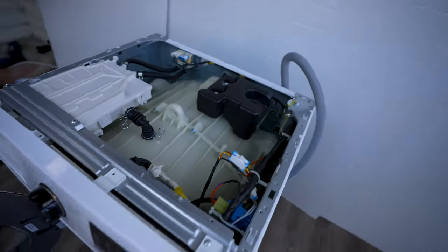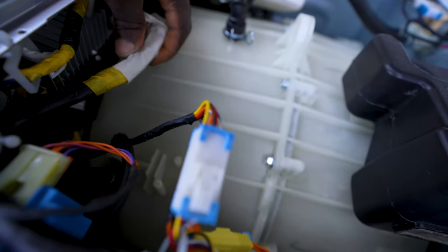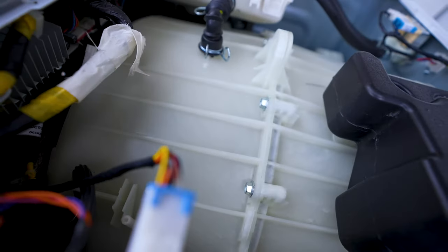We're going to have a look inside here. Normally wiring rubs off and breaks here, but it seems alright — they've put a protective cover on it. Once you've fixed it, make sure you zip tie the wiring so there's no chance of it rubbing. Trace your wiring, checking spots where you think it might rub through. Looking in here, I can see what you're looking for — witness marks. I can see that this wire has been rubbing on something, and there's actually some copper dust from it rubbing.